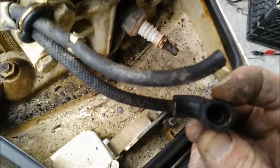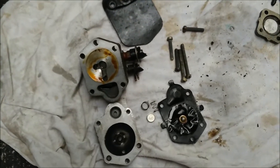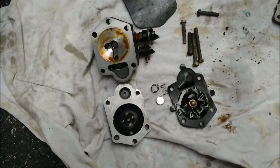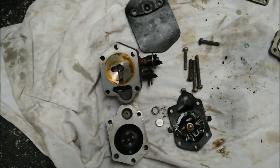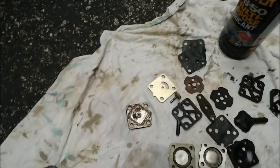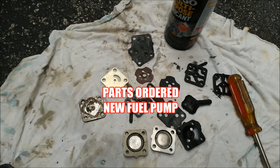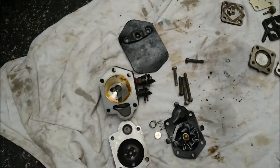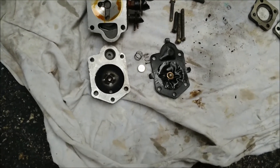It looks a little crusty and rusty in there. I've got the old fuel pump off and it looks to be in pretty good shape, other than the diaphragm is rock hard. For 15 bucks I've got enough parts for a newer style fuel pump, so I'll go ahead and order the kit and go with the new style — unless I can find a cheap diaphragm for this thing, because that's really all it needs.